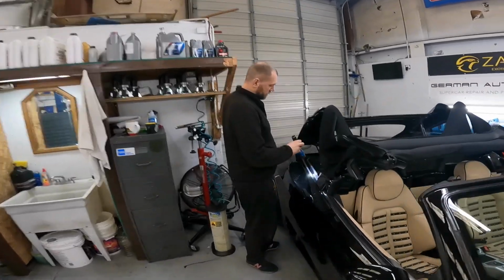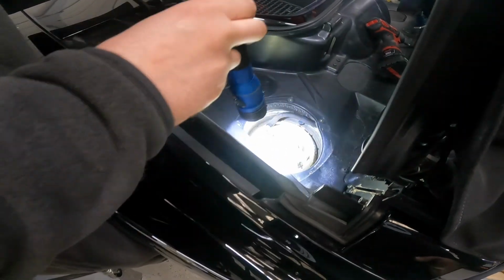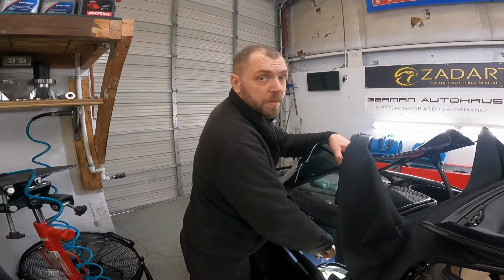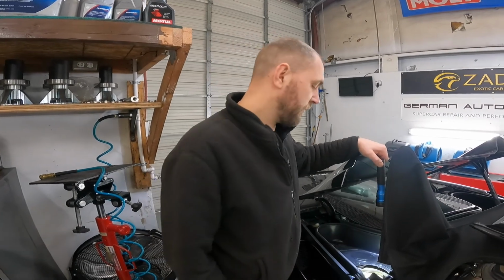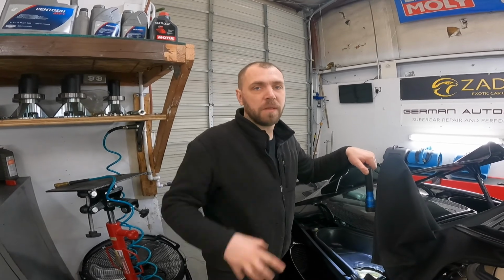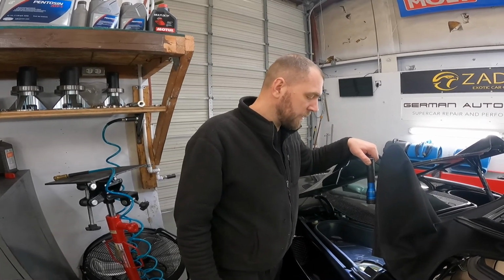Looks like he found something. Yeah, here is the gas smell, here is the leaks, and all passenger side tank, it's wet. I think it's an O-ring from that seal, but I probably wanna fire up and make sure it's not leaking from the pressure hose, but mostly leak from that seal, that tank cap. Fuel pump seal. Yeah, cap seal. Yeah, this is the problem.